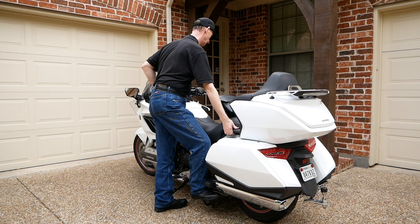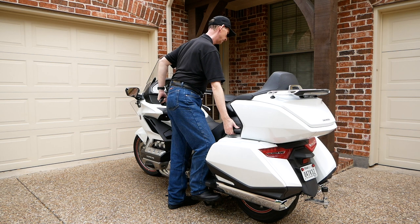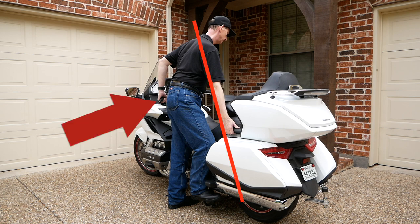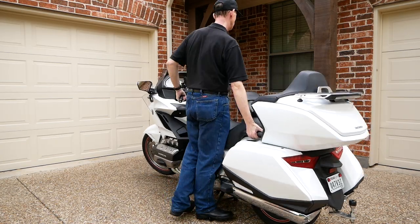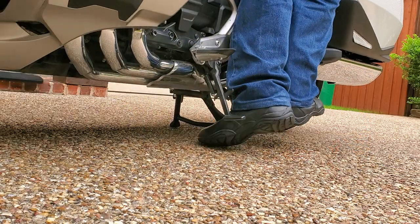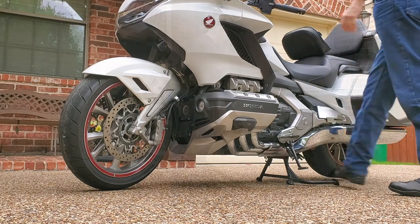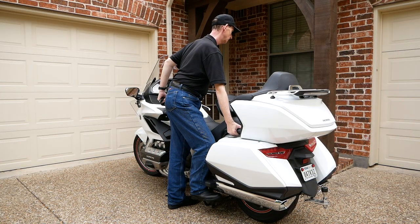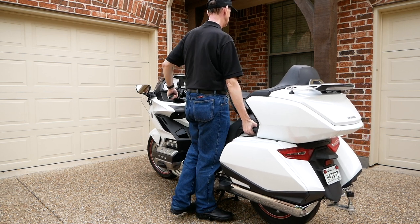With the motorcycle in this position, I hop my left leg as close as I can get it to the bike — that gives me more leverage. The closer your body is to the motorcycle, the more leverage you're going to have. My right arm is completely straight and my left arm is slightly bent as I hold the handlebar. The object is simply to transfer all your weight to the right foot. You'll notice I even swing my left leg out of the way — I'm not using it at all other than to transfer weight. In slow motion you'll actually see my left foot comes up off the ground. I put all my weight on the right foot, straighten my back, and the bike just comes right up on the center stand.